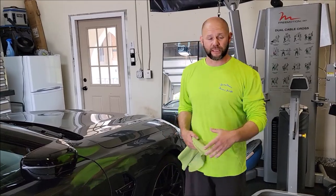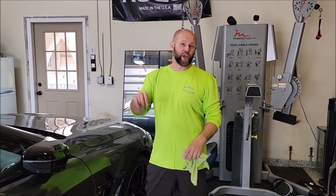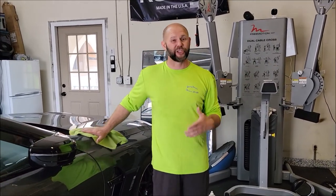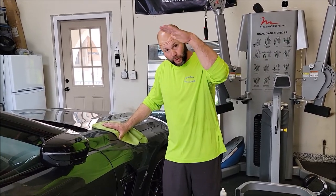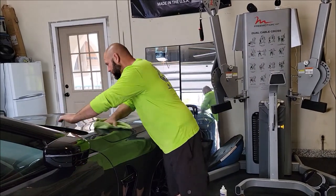And the other water-based polishes like Smart Finish, Smart Cut, even the new Hand Pro Polishing Glaze, if you use it by machine, you still want a pea-size drop. Those water-based polishes don't require a lot of polish, because of our lubrication system, you don't need extra polish, you don't need extra work time. What you need is appropriate pressure, speed, balance, and a good quality polish to get you where you need to go.